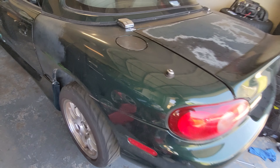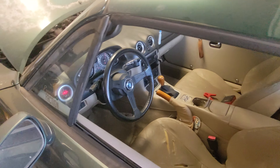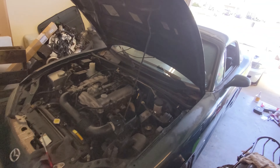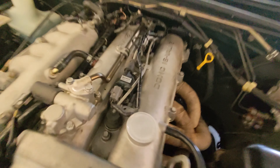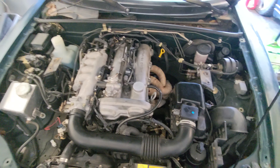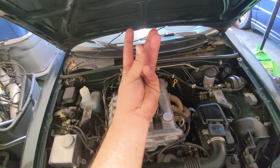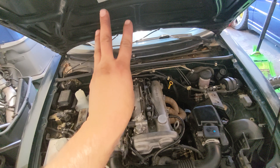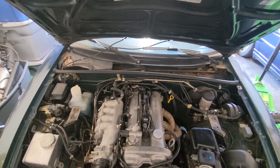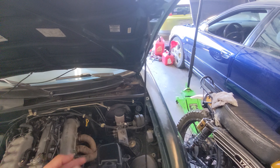We've got this thing running right now. I've just got the car in first gear, going to let it run for a bit. I'm checking for leaks up here in my valve cover — everything is looking good so far. Initially I had a leak right here coming from the top and on the backside of the motor, but it all looks pretty good right now. We're going to bring it up to temp, then shut her back down, drain that fluid out of the back again, and move on to the transmission.